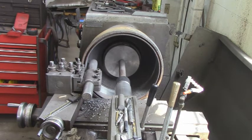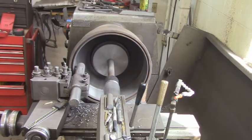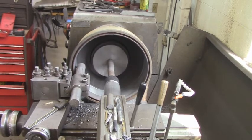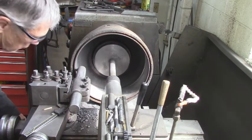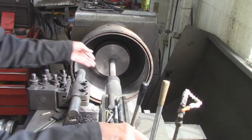That way you could pull it up quite tight if you wanted to. However, this worked on the other brake drum, so I'm sure it's going to work on this one. The other thing you'll notice about my setup is I'm set up to start cutting on the hub end of the brake drum and cut out to the other end. Now I'll show you my hub — for this drum it's a bit too small, but it worked, and that's the important thing.